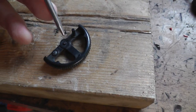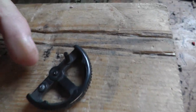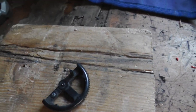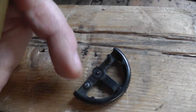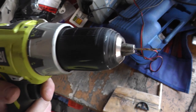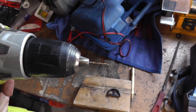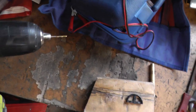What I've done is get a center punch — which is for metalwork — and just center punch right in the center there. That gives me somewhere my drill bit can run rather than swirl all over the place. Then I'm going to file that little nib flat and do the same again. The name of the game is to start small, so this is a 1.5mm drill bit to get the pilot holes. I'm working on some wood so I don't go through my bench.